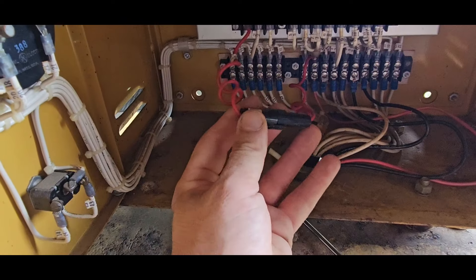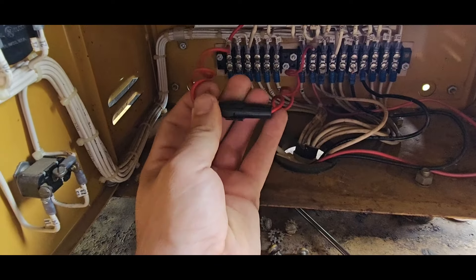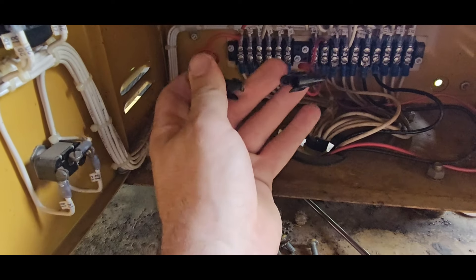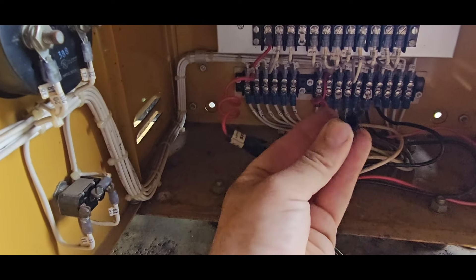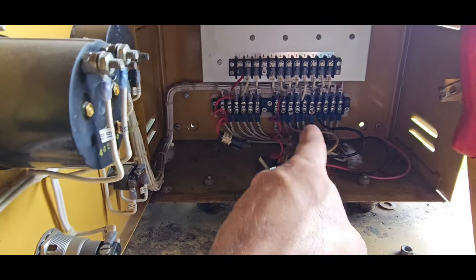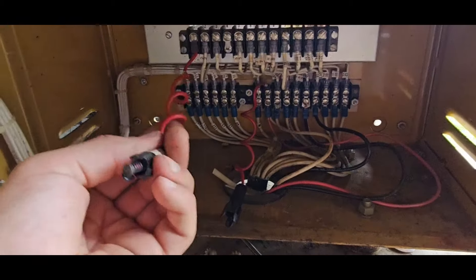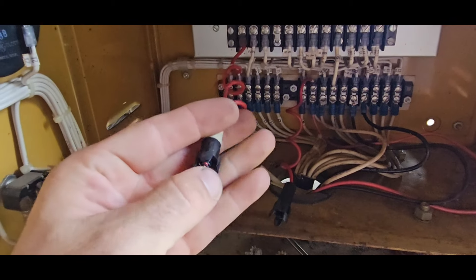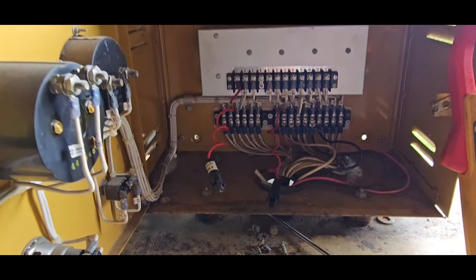I think I found it. There's a fuse right here — why is that so loose? There is no fuse here. Alright, well let's do the right thing and just bypass it. We'll find a fuse later for it. For now, let's just see if that's going to fix it and get this thing at least starting to turn over, and then we'll diagnose and see if it's actually going to start.